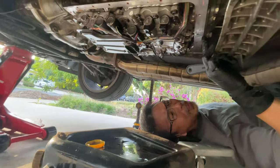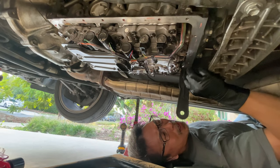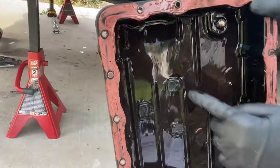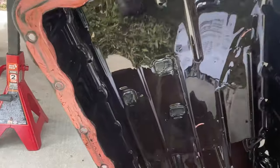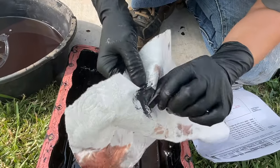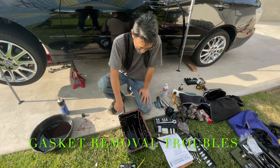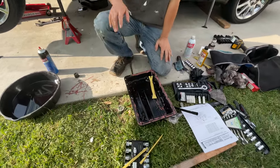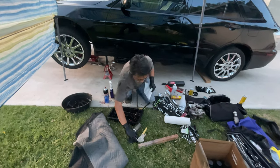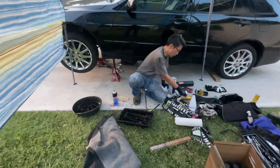It's stuck on there, but those are the pits — there's pits in the surface. I'm going to leave that in the pits; I'm not going to try to dig it out. That's metal shavings from the transmission. Look at that gook — that needs to be cleaned off. Metal shavings and grease building up. This is not working for anything. Less than a quarter done after 15 minutes? Let's give up and go get gasket remover. That was probably an hour of elbow grease and a crud cutter, which broke it up better than the Goo-B-Gone and Sea Foam.